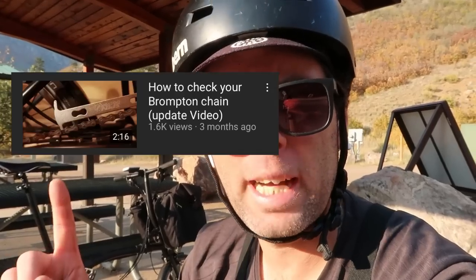So that's something to keep in mind. I did a video a little while back on how to check your chain. Guys, in that video, I tell you, don't let your chain go above 75% worn, because once you let it get above 75% worn, it starts wearing your gears in the back. And let's say if it gets to 100%, you're going to be replacing the gears and the chain when you go to replace the chain. So it's just added expense that you don't want to have to incur.